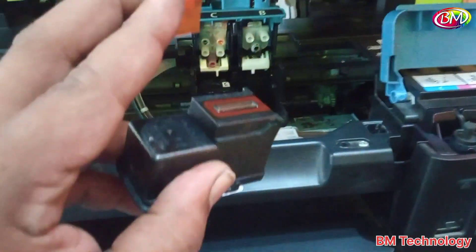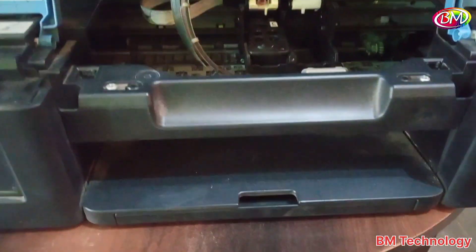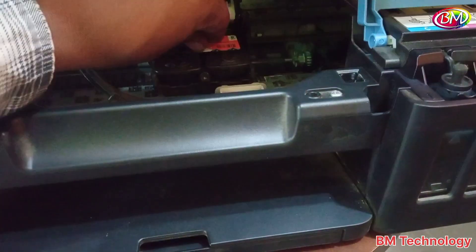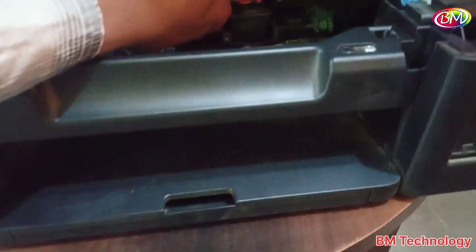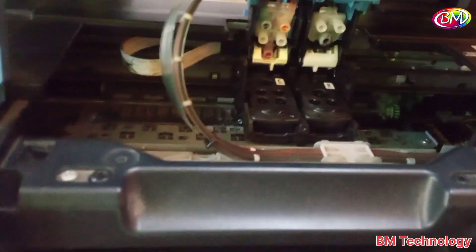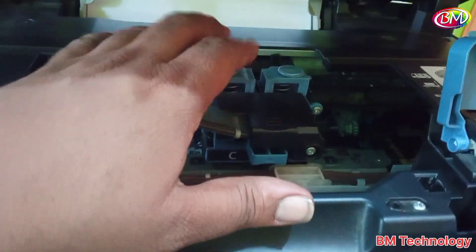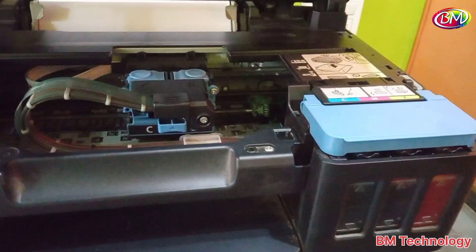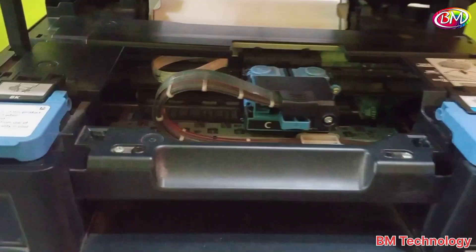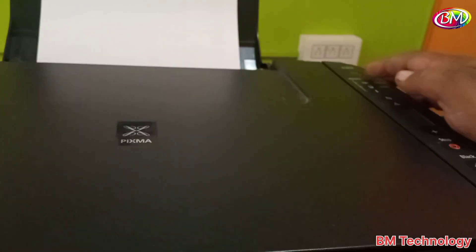This is our new cartridge head. Open the new cartridge, remove the strip, then insert the cartridge into the carriage unit. Remove the sticker, then close the carriage unit cover and lock the cartridges. Press both locks and close the refilling covers, then close the scanner cover.